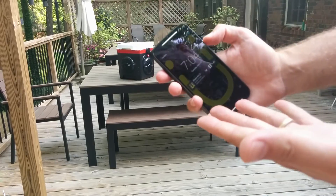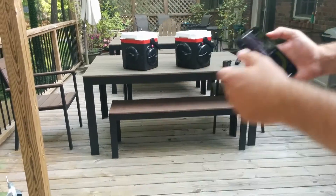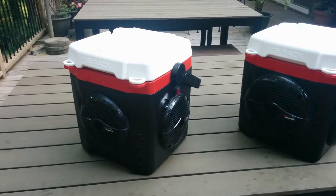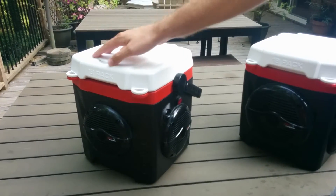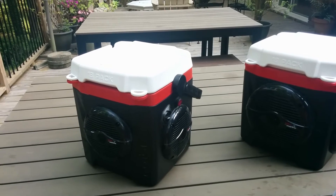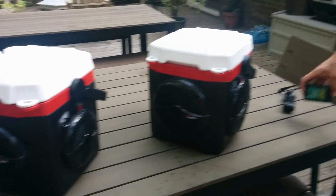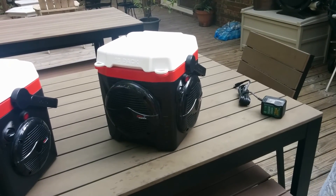That's not even all the way up, but it gets pretty loud. I'm gonna pause it here. The controls are on your phone over Bluetooth. To turn it off, just hit the off button — that's it. When you want to charge it, turn it off, plug in the power, and you can let it sit there — it'll never overcharge. This charger is smart; it knows how to get the battery to the top and then it does what they call float charging.